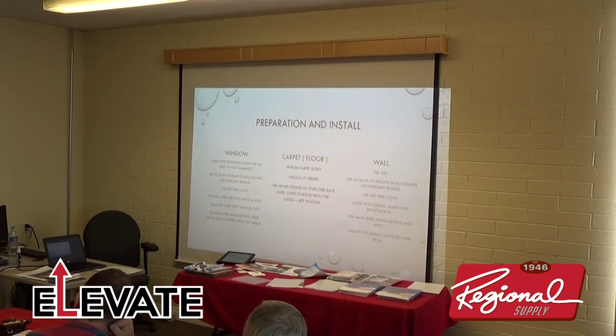All right. As far as adhesives go, the Street Wrap is our most aggressive. The H2O would be our second most. Okay. And then it has a temperature usage range, and the unsealed one is like 32 degrees to 225. The others are like negative 40. So if you're in a place where it gets really cold, you might want to stick to maybe the carpet one, even if it's not quite as aggressive. Yeah, and that would be the service range. It would have to be applied in temperatures above 40 degrees. Oh, okay. So once it's cured, it can be negative 40 degrees outside. Okay. All right.